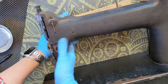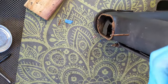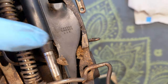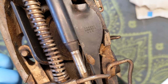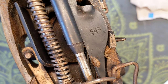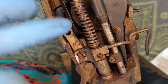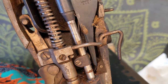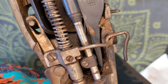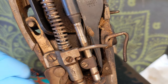I can see part of the very, very dry oil wicks here. Let me tip her up so you can get a view of what I am looking at. In here — these parts here are part of the oil wick system. They're extremely dry, this is all very filthy in here. I believe I can take out the lifter bar and the needle bar, but I'm going to be leaving the oil system area intact as much as possible. But I'm going to need to remove all of this because it's locked up — I can't lift the lifter lever. You can't sew if you can't lift the lifter lever.